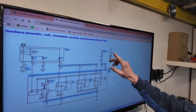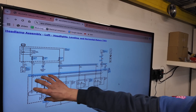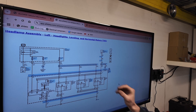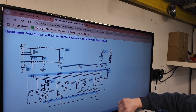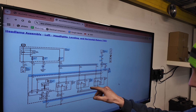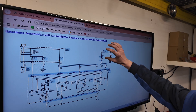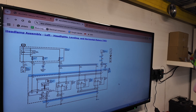I'm going to take you to the diagram and we'll have a little scrum down of what the plan is. Here we are at the diagram - this is for the left headlight and we've got another one open for the right. So here we've got our headlight assembly and inside we've got our control modules for the levelling - left, right, up, down, high beam. And it all comes in through this wire - this is our LIN bus wire coming into the headlight. What it does is go through all three modules. So if one of them gets knocked out, or there's a broken wire inside the headlight, it shuts it all down. So if we've got a problem with the LIN coming in, we know it's outside of the headlight. If we've got a good LIN coming in, we know it's most likely going to be inside one of the headlights.